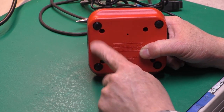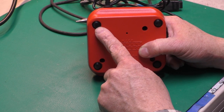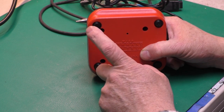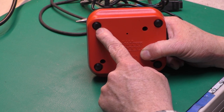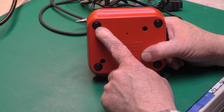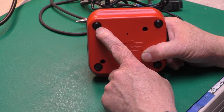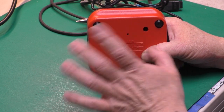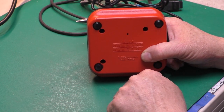I also replaced the rubber feet on all three of these joysticks, and I found they are exactly the same size and shape as the ones used on the Commodore 64 itself. I bought a whole pile from the manufacturer and will have those on my website shortly. I'll put a link to the replacement springs from the place I bought the centering grommets down there too. My suggestion: if you're going to replace the centering grommet, go ahead and order that spring and replace it at the same time, because the spring is inexpensive and you don't want to not have it when you need it.